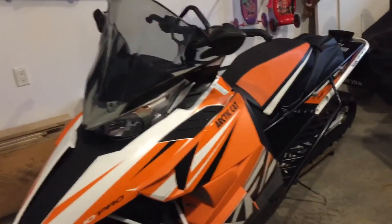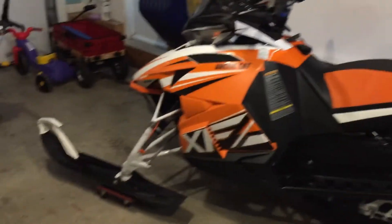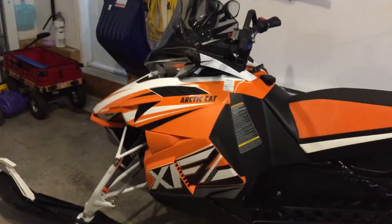I have one season with this machine and 1,011 kilometers on it. I'm up here in Canada and I really do enjoy it — I actually can't wait to get it out for a ride. I've been dealing with a lung infection or I would have had it out by now. We have enough snow for a ride on the roads at least, the old fire roads. She's ready to go — gear case oil changed, power valves cleaned, belt adjusted, new ski runners, and a grease job. She's ready to rock and roll.